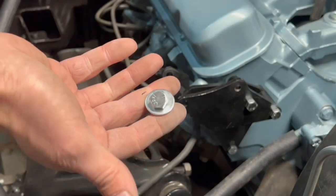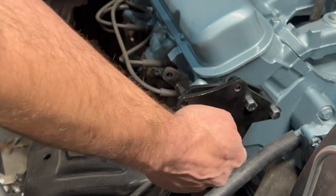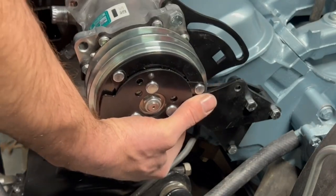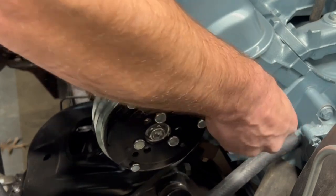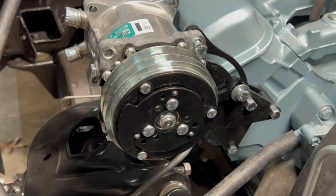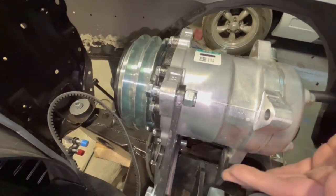Here's the shortest bolt in the kit — put the big washer on the end of it. It's going to go into this threaded hole here, and this is what the adjustment bolt will be. The compressor pivots here for belt tension adjustment. Here's why bolt number two gets left off: I can now take the compressor assembly, drop it cleanly into place without damaging any of the paint, and then put the adjustment bolt in. Then we take the pivot bolt — that's bolt number two — and stab it through. I didn't have to juggle everything at once. Now I just need to put a nut on the back and our compressor is basically installed.